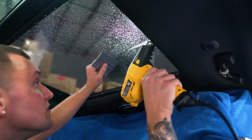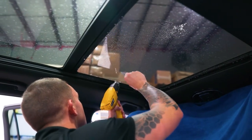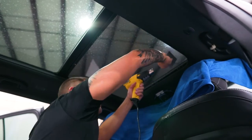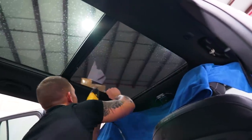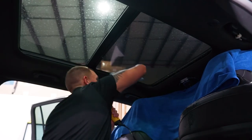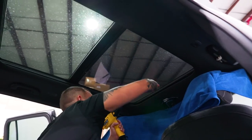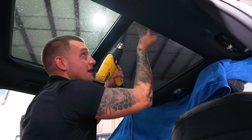Now we've got to shrink these fingers - heat gun on high, great way to go. Hallelujah! That's it - sunroofs. You can shrink them on the outside which makes it a lot easier, but if you've got enough film on the inside, wrap them on, wet shrink them on the inside, and at the same time you're sealing the perimeter - killing two birds with one stone. If you're doing pre-cuts this is the best way to go: you don't have to wipe the outside of the window, you don't have to lay the film out there, and you're sealing up the edges as you shrink.